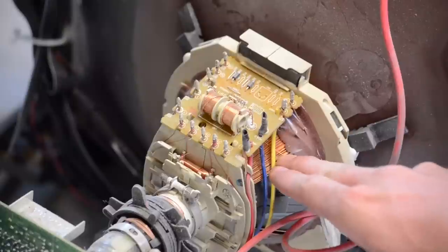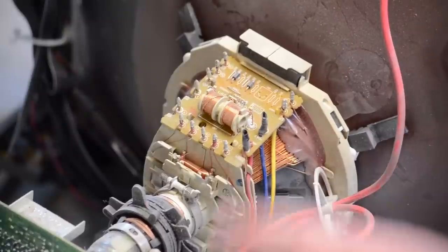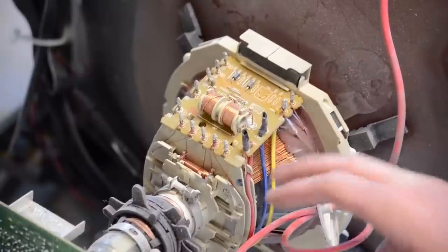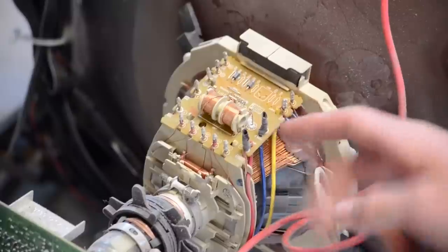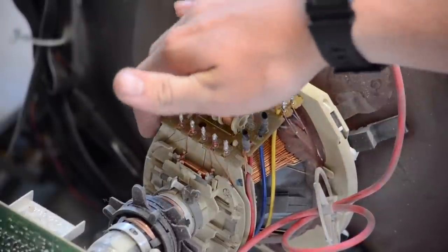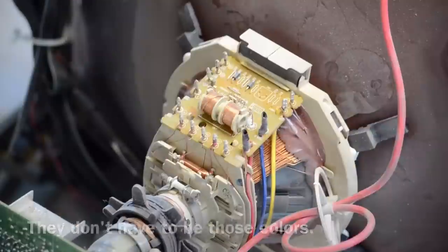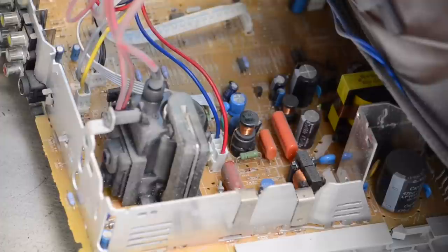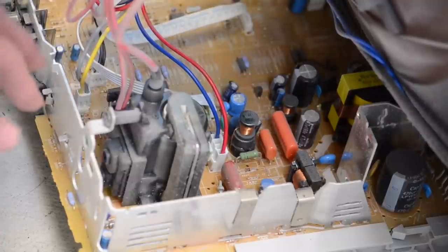On the paneling above these two coils there's going to be a horizontal and a vertical coil — I'm not sure which is which here but we'll find out in a moment. You'll see pairs of wires: a blue wire, a red wire, a yellow wire, and a gray wire on the other side. The blue wire is connected with the red wire and the yellow wire is connected with the gray wire.